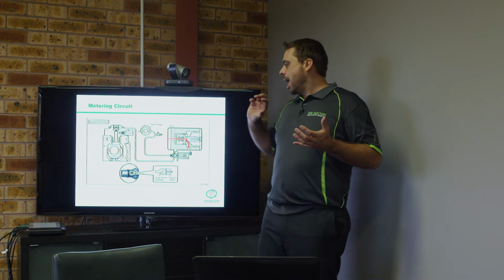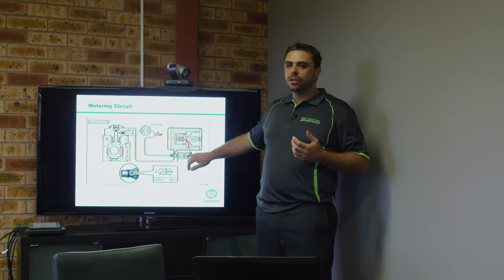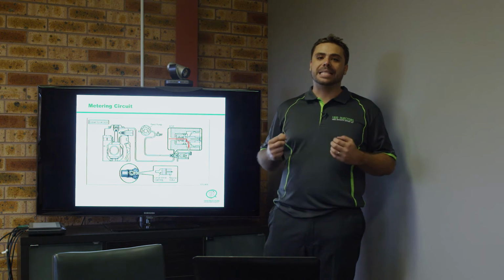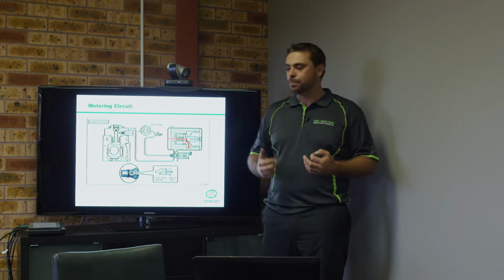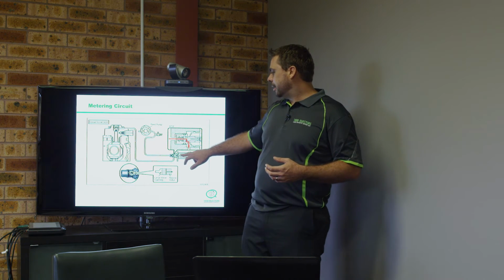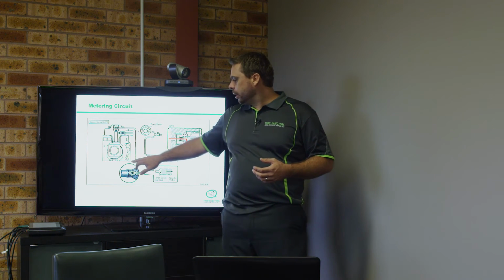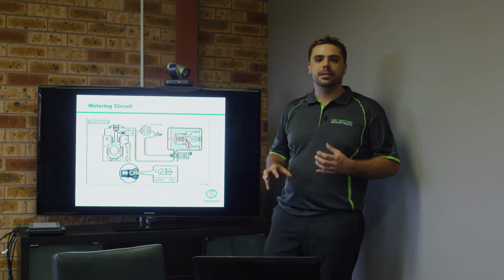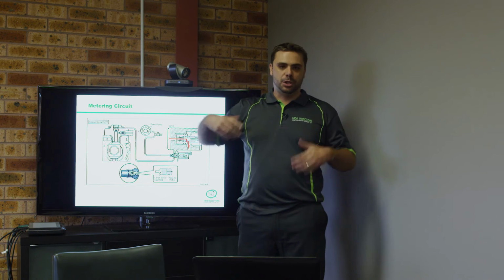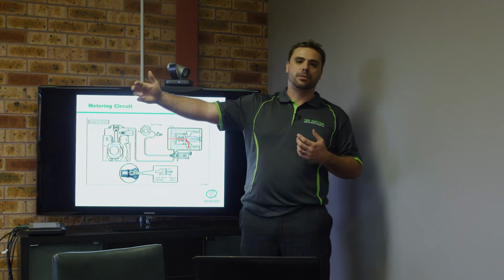So if you think about it this way, the suction control valve is actually a metering valve, but what it's really doing is acting like the throttle of the pump. The feed pump supplies everything, but the suction control valve only lets a very precisely metered amount of fuel through to the pistons that are then pumped, which uses all the energy, to the rail.